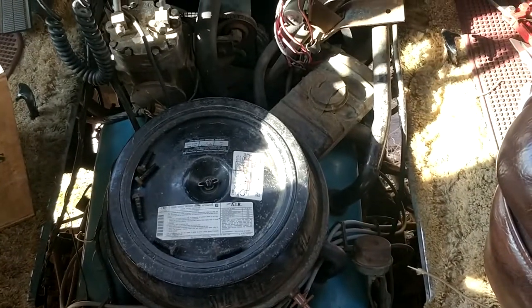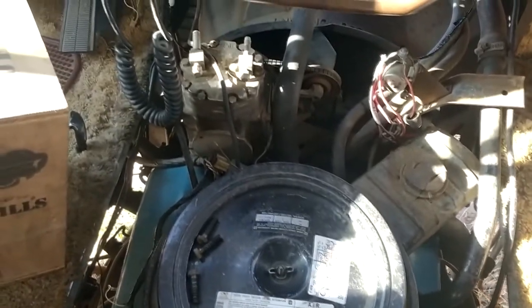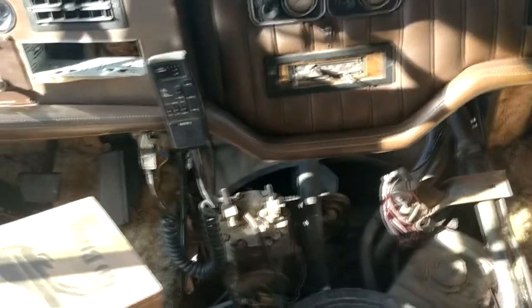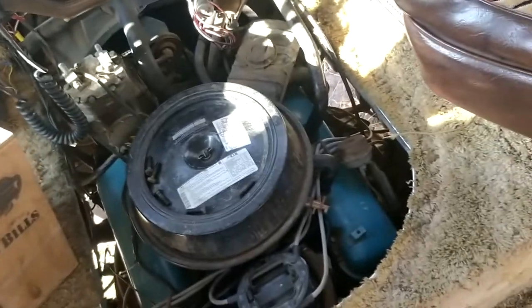I replaced the plugs and wires, rebuilt the carburetor — it's a Quadrajet, which I like. I hooked up the old AC compressor, which we're going to use for an onboard air system — I've got to put a tank in. It's a piston-style compressor, a York style though not a York brand unit. Got new drivers up front, I've got to get a radio for it. The timing was at 2 degrees base, and I set it to about 8 degrees now — a little better, less emissions-era tuning.